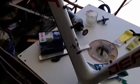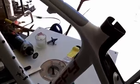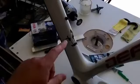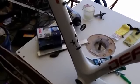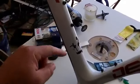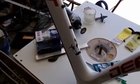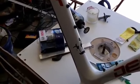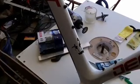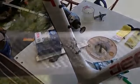The other alternative is to remove all the paint, and he didn't want to do that. So what I'm going to do is just repair this section here and see how it goes. The bike still feels pretty solid — it doesn't feel crunchy in any other areas. I checked all over the frame, so I'm pretty sure this is the only damage. I'm going to tape off this part here and then probably down here somewhere. I'm going to try to use acetone to get rid of the paint; if that doesn't work I'll have to sand it.